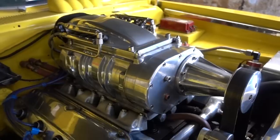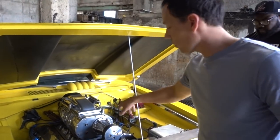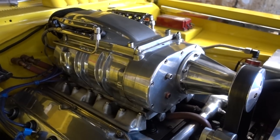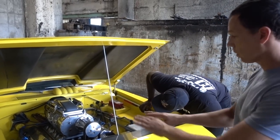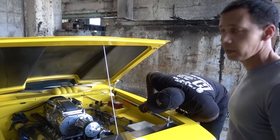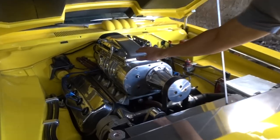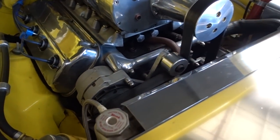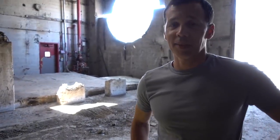And now let's talk about your supercharger — the V671. It doesn't have the standard bottom bolting flange on it. I just didn't like the way the standard ones look, so I built that one and made the manifold to mount it. I like the cleaner look of it being more tucked in instead of the big bolting flange on the outside. All the parts that accompany it — the drive, the gear cover, the injection, the manifold, all the water crossover and mounts — I made all of that. This is one of a kind, and it's awesome.